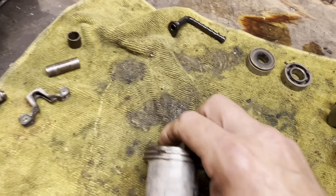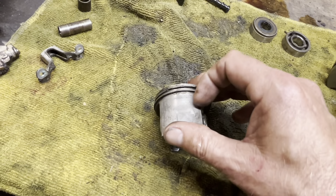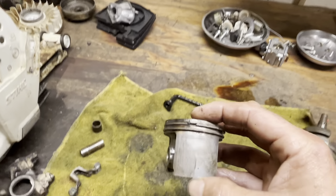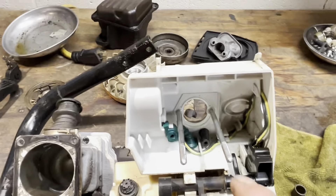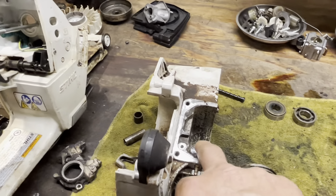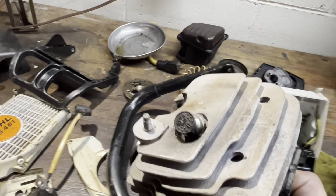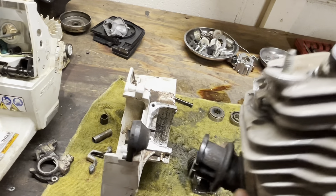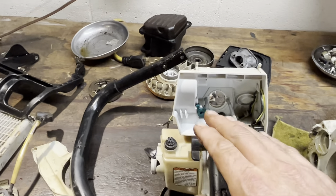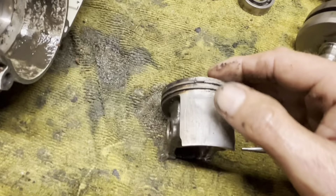Here's the intake side of the piston. I saw some guy bitching about his saw being rejected for warranty, and he had scoring on the intake side of the piston — that's typically going to be a lack of lubrication. As your fuel comes in here, it's brought into the bottom of the crankcase. That's the least amount of heat; all your heat is up top in the combustion chamber. So from there down you'll be running much cooler temperatures, and with a steady stream of fuel going through that boot hitting the intake side of the piston, you shouldn't see scoring like that.